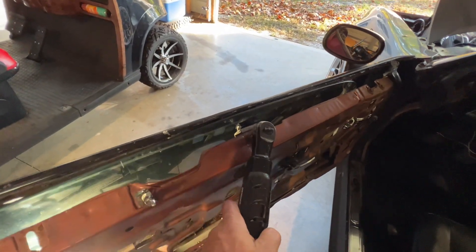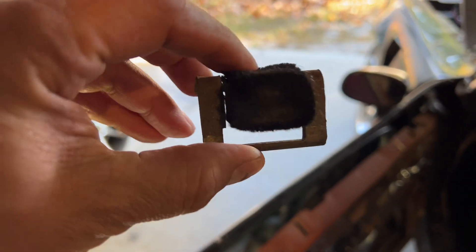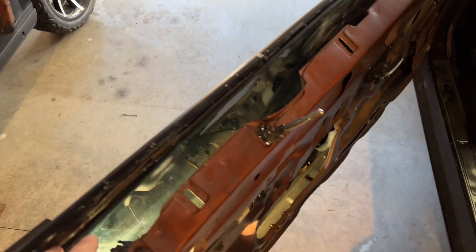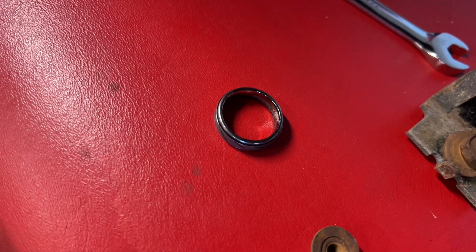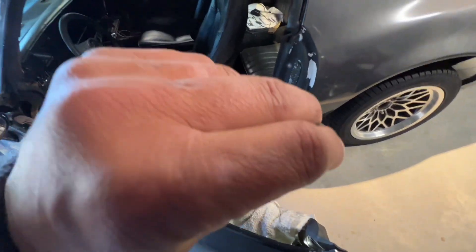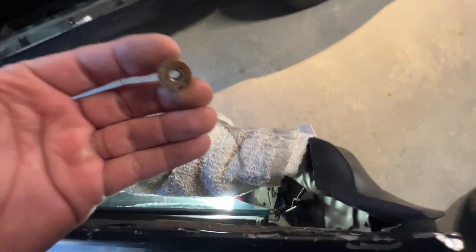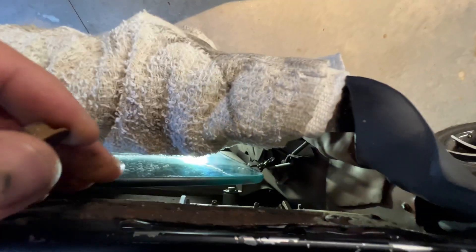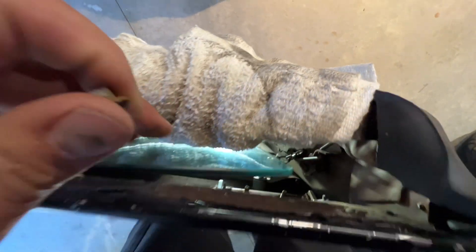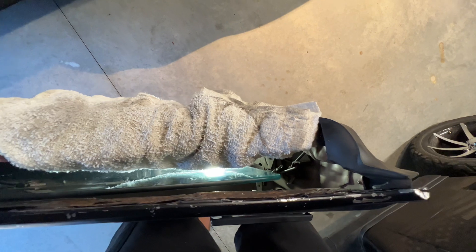To get my fingers in there. They come out pretty easy and they're self-threaded — they have threads on the bottom — so just catch it as it falls. Those little felt runners. Now I have a little more push on the window, but you don't want to hold it too much because it'll scratch it on the other side down there. Now it has a little more movement. First of all, I apologize to the wife — I had to take my wedding ring off because I couldn't get my hand in there. I have generally bigger hands than most people; I'm a tall guy. That was the hardest part, getting those two fingers around it and working it out. It was actually easier for the inside one. Put a rag in here because there's a little track right here — don't want it to scratch. I put a light down there because it's a dark spot. We have them both out.